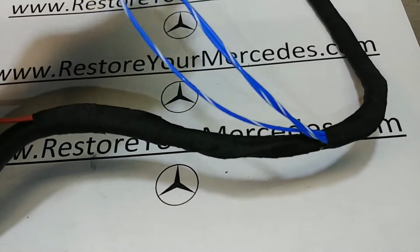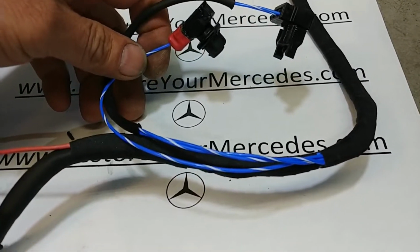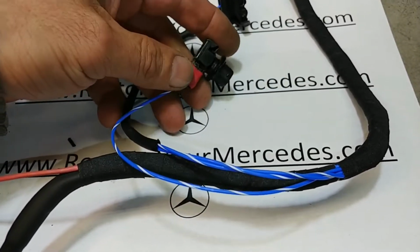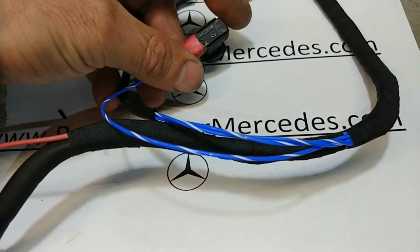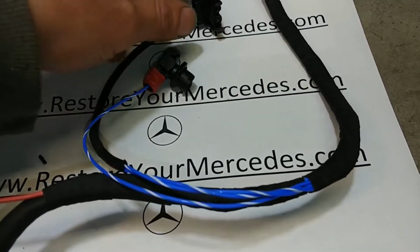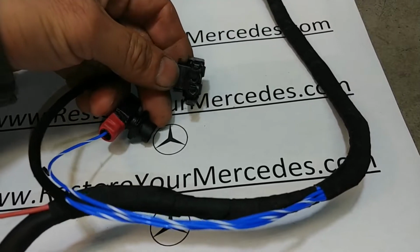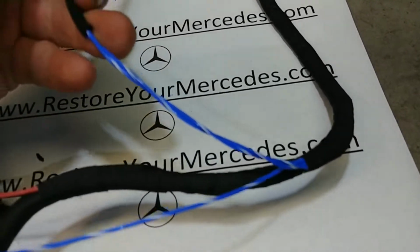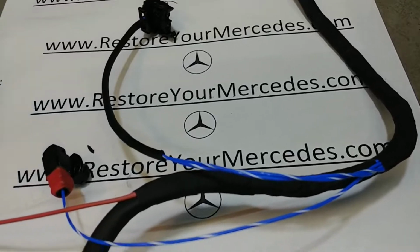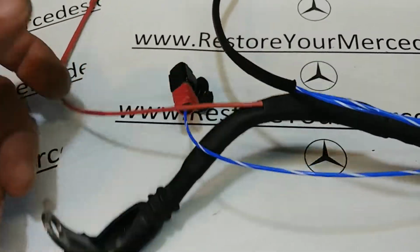So these wires come out a little bit away from the alternator, because this is where your oil pressure, oil level sensor would be. Now the rubber grommet on the oil level sensor pretty much always falls apart, so I just put a little bit of wrap here so it would remain together. A new plug, new end here on the oil pressure switch. Actually, I'm also going to wrap up this section right here, just because I can. And the alternator connection, and the alternator main power line. So, and this is it.